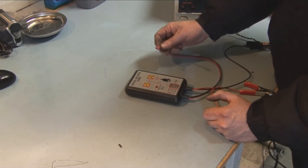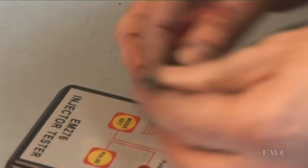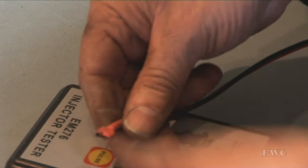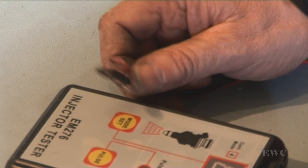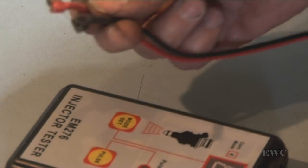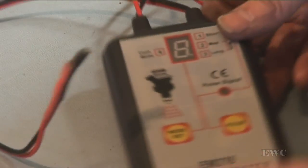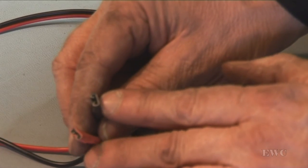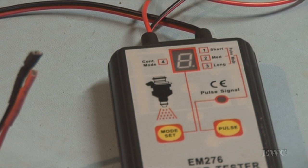It's a little bit awkward to use because these connectors are way too large for the Nissan type injectors. You would have to make yourself up a few adapters for each type of injector with this type of fitting on each adapter. I would suggest as you're doing cars, snip the injector connectors off old cars and store them for yourself, and put some male-type spades on them to join into these female-type ones. The unit works apart from that. It would be nice if they gave you a few different types of connectors — smaller type of connectors. But for the price you can't have everything. I hope that's some help out there for someone. Thanks for watching.